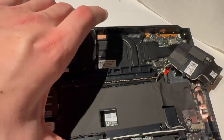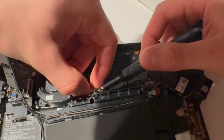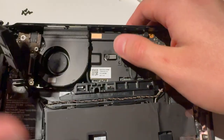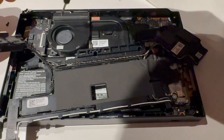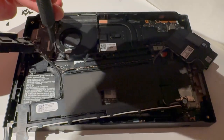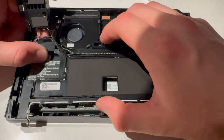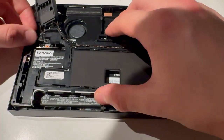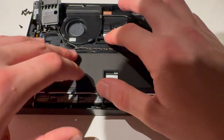I'm just going to do this over the trash can — just wipe all that dust out, and boom, wiped that out. Now I'm going to put this back in and then put in the connector. There's a connector right there; I have to put that in. It's much easier to do when you don't have a camera in your face. Let me just do this off camera — basically just push that connector in there. Now put in the screws for the fan. Watch out so you don't over-tighten them — you might strip the screw.